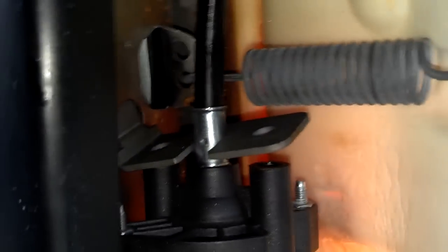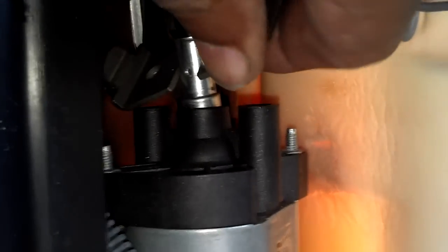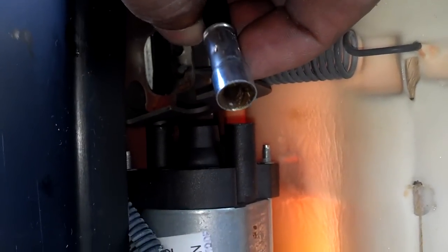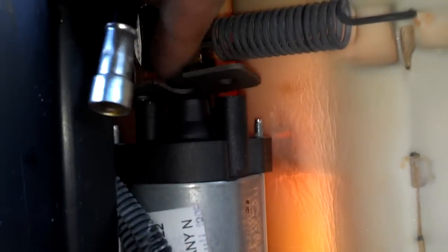After you've got both of those screws out, you lift this bracket up and get it off the cable. Now as you can see, when I pulled the cable out it's not showing any tip of the cable sticking out of there, and that's not good. That's probably why it's not catching in the transmission.